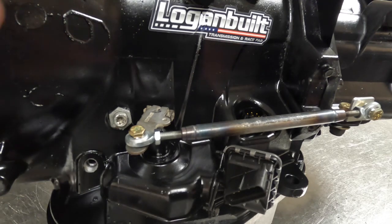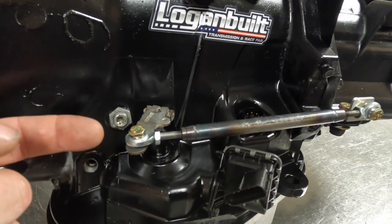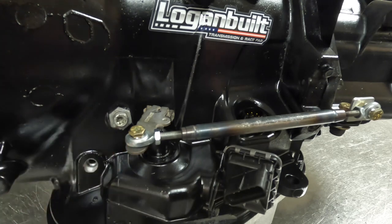On the gear-in stuff, we use the throttle valve to time the 2-3 shift, because we do everything with a constant pressure valve body — the line pressure is already preset from gear-in when you get it, so that allows us to open up the throttle valve for 2-3 shift timing. I tell all my customers to leave it loose, fully extended with no preload on the TV, and go drive the truck. Once everything's good, make a wide-open throttle 2-3 pull, and if you have a flare — engine RPM revving up between the 2-3 shift — start to tie this back in small increments until the flare goes away. The 2-3 shift is the most complicated shift in this entire transmission, and this gives us full control over getting the exact perfect timing of it.